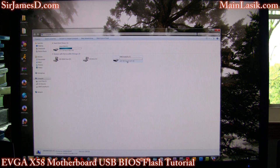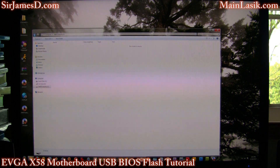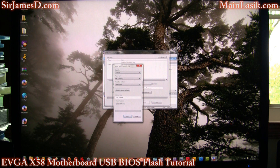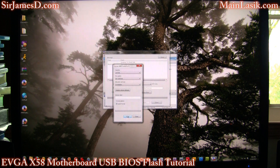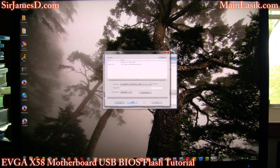Now is where we need that flash drive. It'd probably be a good idea to erase everything off of it, so just delete everything first and then format. Make sure this is the jump drive — it says USB HDD. You can either leave the label blank or leave it default, FAT default is just fine. Quick format — it'll take about half a second, less than that. And now write. Do you really want to continue? Yes.